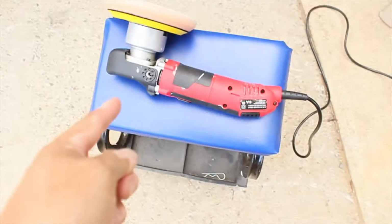Wow. So I realized half of my rear door was only polished and for the most part scratch free. So I ended up doing the other side. Same process, correcting pad and 105, but this time I did 3 passes instead of 2. And well, as you guys can tell, that big old scratch is a lot less visible than what it was before.